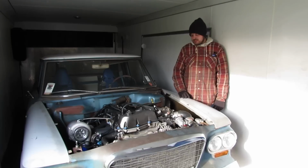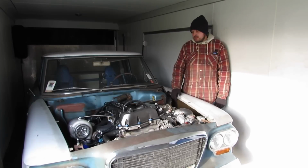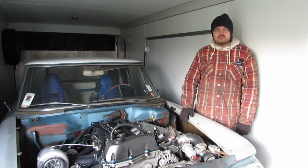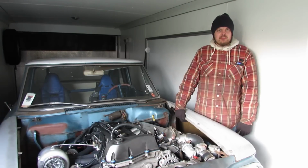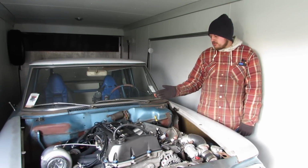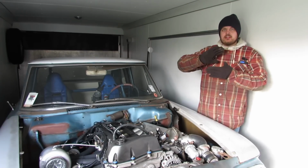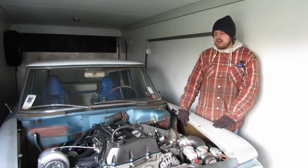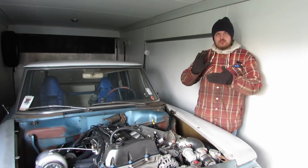Alright guys, so after talking in the truck, we have a lot of conclusions that we can take away from this dyno session. The VVT control, I just want to say, reads an angle in the computer. So I took that as it's reading the cam sensor right. The engine starts, idles, runs sequential, no issues. That being said, the exhaust cam on a Vortec 4200 should see 25 degrees of phase change over its travel. So it should go from 0 to 25.